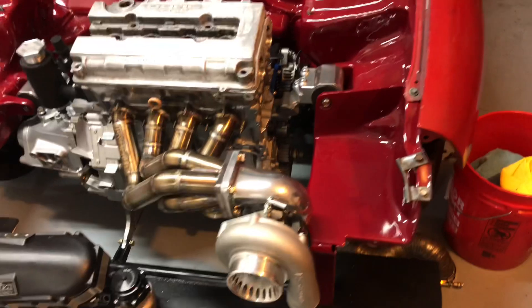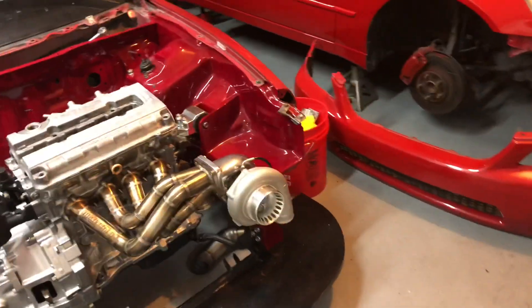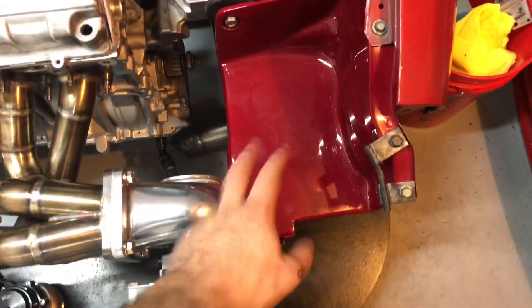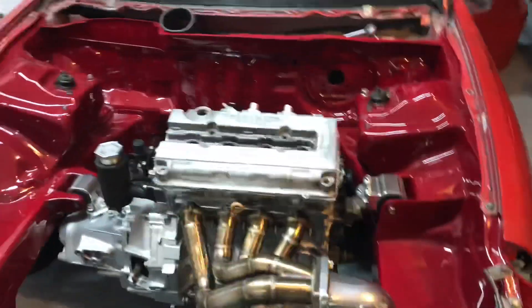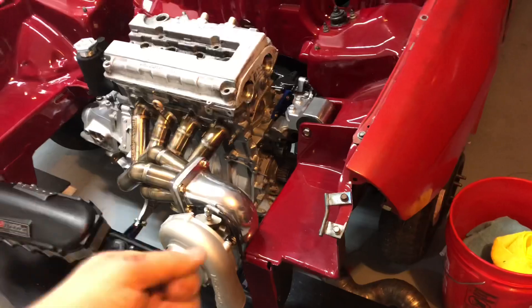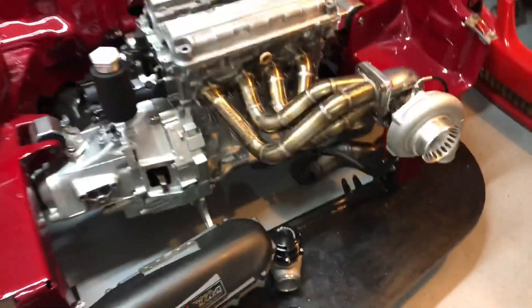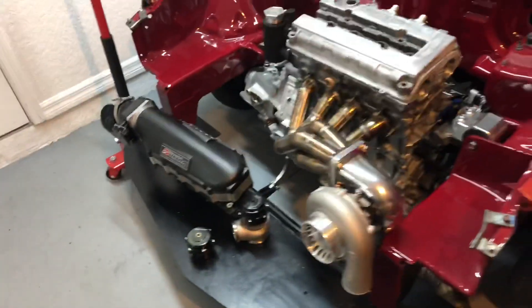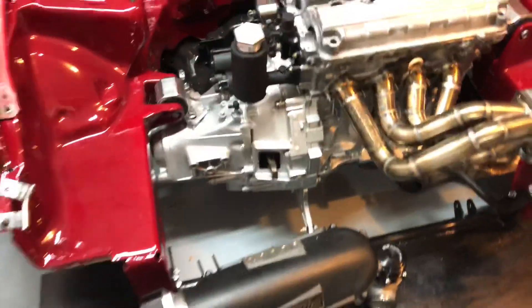The little trick for that: the oil lines you can get from eBay, the cheap ones, are about $30 to $40 but they're a little bit shorter than what we needed. So we ended up getting a Clutch Master to Slave tucked line, which is also a Dash 3 AN, a little bit longer since it runs from that side to this side. That is like the perfect length — it's also AN, it's braided, and it has a coating over top of it so it's nice and resistant to scoring or cracking. As for the intercooler, I'm going to get an intercooler core — probably a CX Racing unit, like a 5-inch or something — and build end tanks off of that. I'll also buy some straight 3.5-inch piping, same as the throttle body which is 90mm, and build some piping off of that.